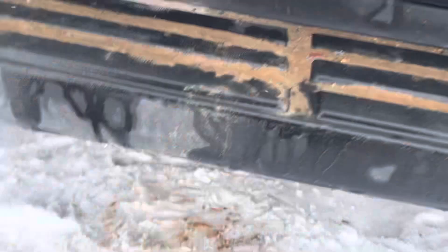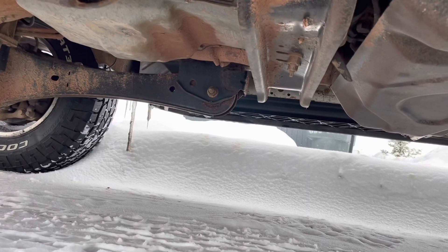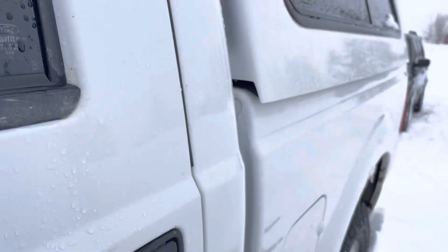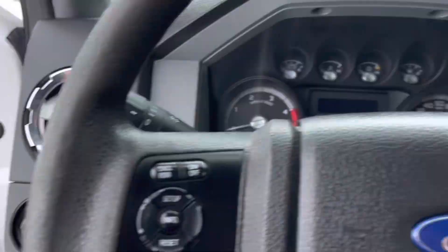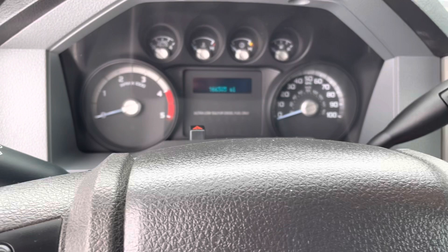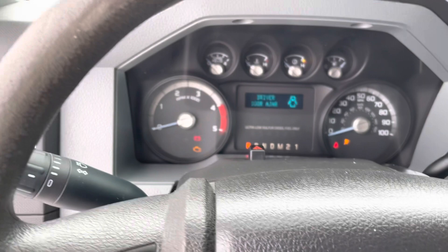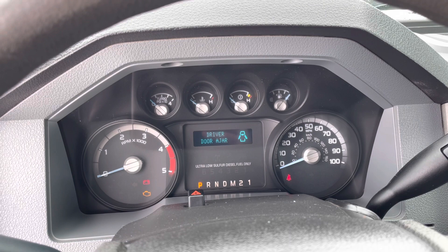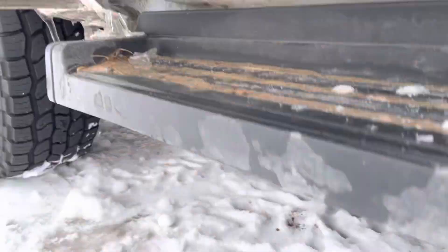I don't see any leaks in all the lines I put back together. Nothing is dripping — that's good. Now the moment of truth. I forgot — after you do the fuel filter, you're supposed to charge the system: 30 seconds of key-on, not starting the car, just clicked over so it's pumping fuel back into the system. You do that six times. I can hear it pumping, so I'm going to do that now.